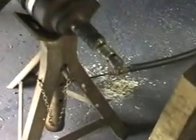So basically now I'm going to take this up onto the bench and we can have a good look at how we disassemble it. You would not take it out like this from the car — you would first take off the caliper, then take off the disc. You would then try to undo these, and you would have to take off the castle nut as well. I'll tell you what size tools you'll need for that, so we'll just break now and put this up on the bench.